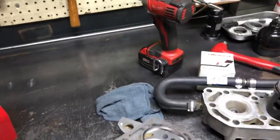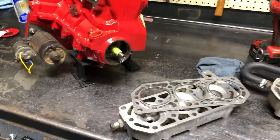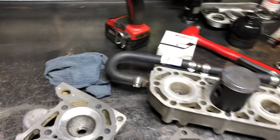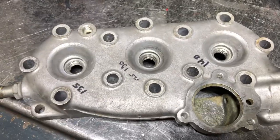We're going to take this to the museum out in Sturgis and keep it to show people, because it is an interesting piece. It is set up and ready to run — all I've got to do yet is put on the front pulley. I think the pulley's out being powder coated right now. We ran compression on it and it didn't have as much compression as I thought it would, especially given the big durations it has.